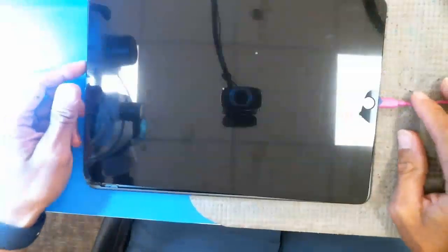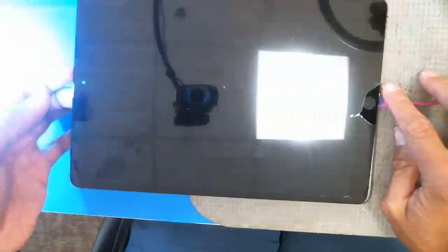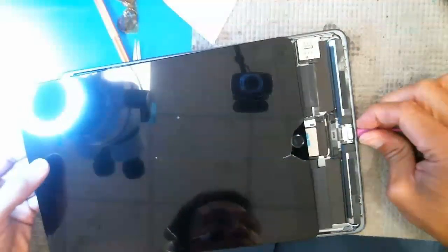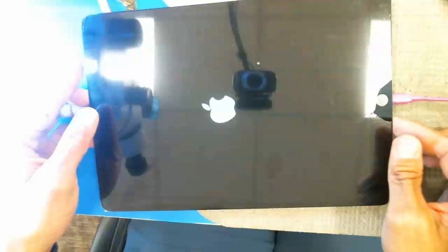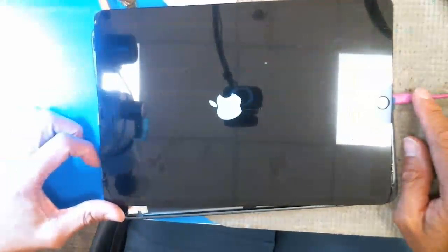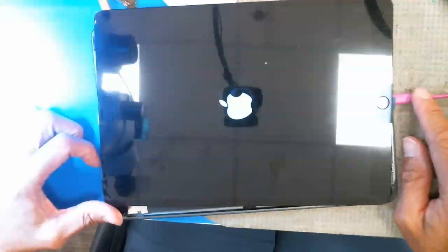Let's plug in the lightning cable. Okay, I have one left — just make sure it's getting the correct power. I'm getting zero amps at first, but this lightning jack wasn't plugged into my main ammeter — it was plugged into another one. So it's drawing about 0.93 amps now, and the Apple logo is on.